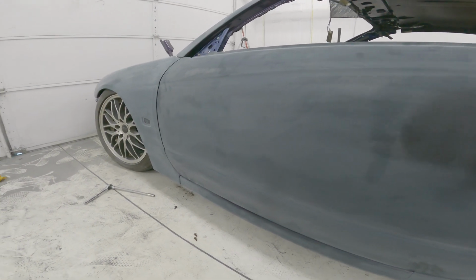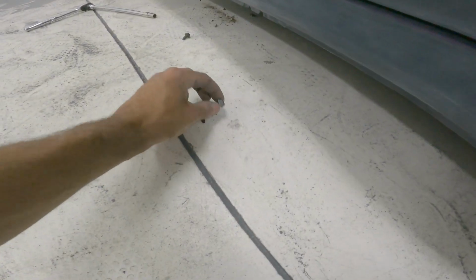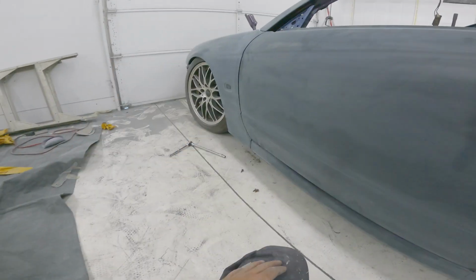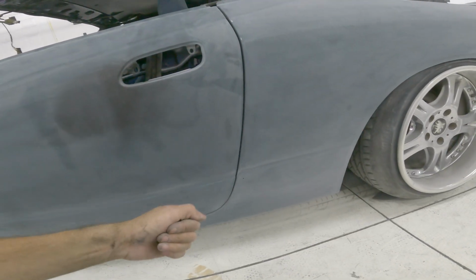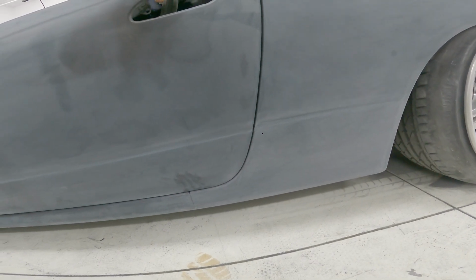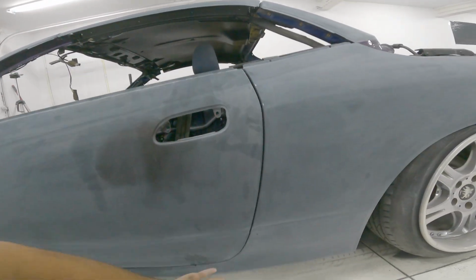So now I gotta take that fender off, which I was trying not to do because I didn't want to break the bolts on the bottom, but I actually got them out. They're really crusty, but both of them came out, so I guess not a big deal. Hopefully once I get that fender off, I can loosen off the bolts on the hinges and just lift it up a crack and get that to go up. But that's gonna open this up so I'm gonna have to undo the top one and move it back to close that back up and make this a nice gap.